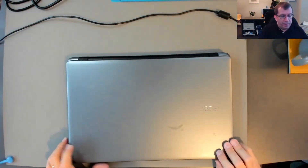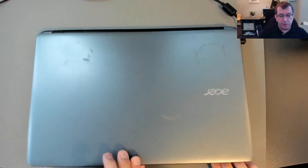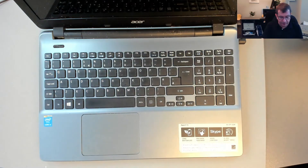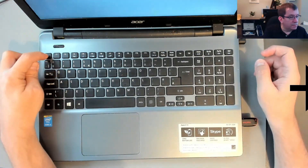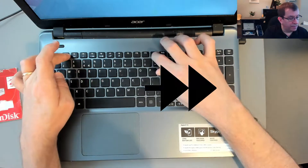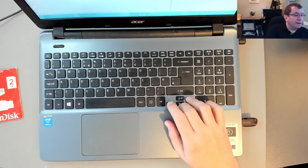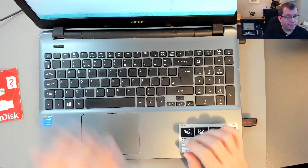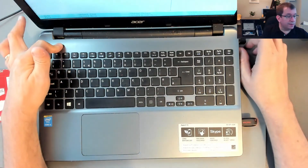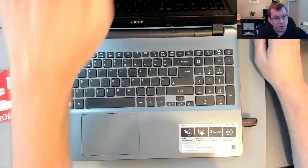I'm going to see if Partition Wizard can even see the hard disk. It probably won't be able to, but it's worth knowing, because sometimes cloning hard disks through the native hardware is simpler. So it doesn't even see the hard disk. I think I'm going to have to take the hard disk out, plug it into my USB adapter, and see if I can get at it that way — but I'd say it's probably unlikely, and this might just need a fresh reinstall on a new SSD.